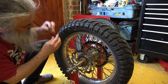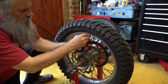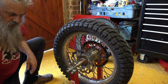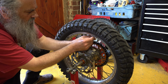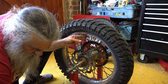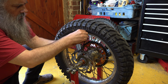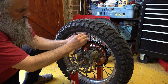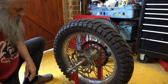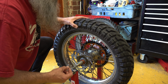So again, I'll just do it by trial and error and see what fits on there and balances it out. So start with that weight, put it at 90 degrees, see what happens. Just not quite enough for that one, still spinning back up again. Try something a little bit bigger. Try this one. I think that's the same size weight as I put on the front wheel actually, so let's see what that does. That's going up slightly, 90 degrees that side, going up very, very slightly.